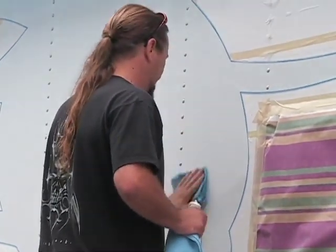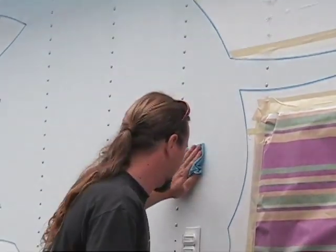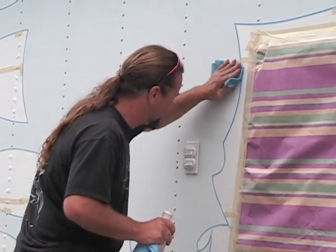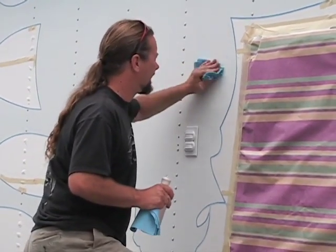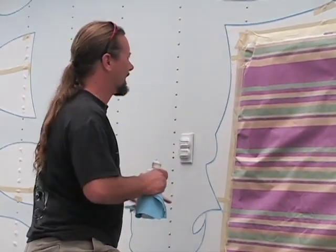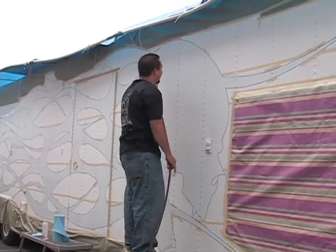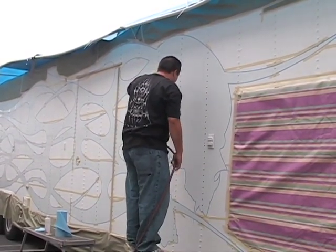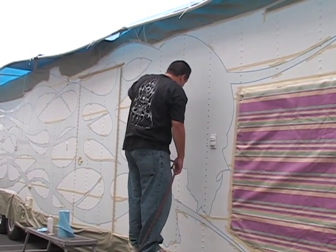Now with pre-cleaning it, using a wax grease remover, going around, wipe on the wet wax grease remover, cleaning the surface, and then come back and wipe off the wax grease remover. Now Johnny's air drying it, air blowing it out, making sure there's no solvents behind the rivets.